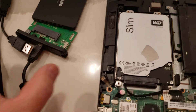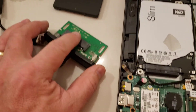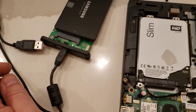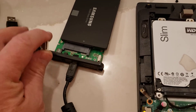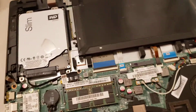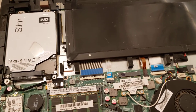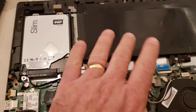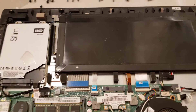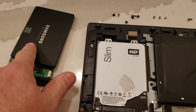Before I took the computer apart, I took this little hard drive converter board — a USB to SATA connector — and basically you plug the solid state drive into that connector. It's a two-and-a-half-inch drive, and then you plug your USB connector into the computer. Then you go to the internet and search for the Samsung Data Migration program, download it to the computer with your old hard drive, run their data migration program, and it easily copies whatever is on drive C over to the SSD drive.